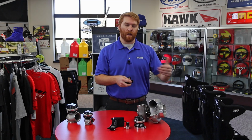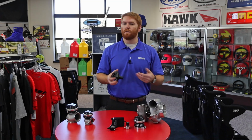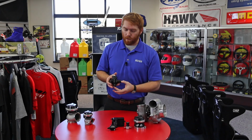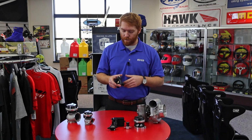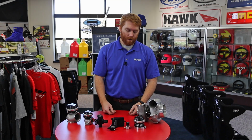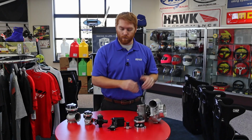It's needed because the engine already measured that air volume. The other thing that this works really well for is if you're trying to be more subtle, it's a street car. You aren't trying to burn the town down or anything like that. You're just trying to get to work. This recirculation valve helps to keep the noise down. So it does help to keep your neighbors a little bit happier with you. So that's basic boost control on the cold side.